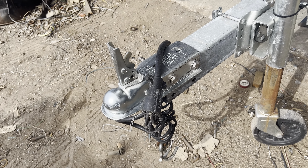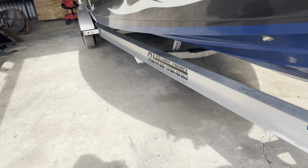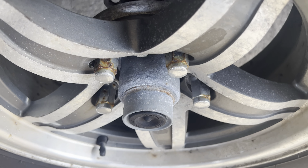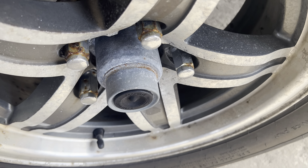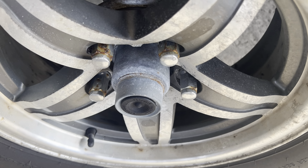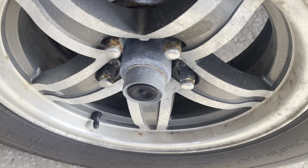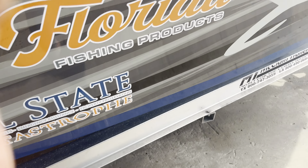We'll talk to him every month and see the progression of everything. He also has a seven-round connector on the front, which most boat trailers have as a five-flat. One more thing to point out: the lug nuts. On trailers, aluminum wheels are known to back off when they're new, so you have to re-torque them at 25, 50, and 75 miles. I'm going to replace these — chrome lug nuts on one axle and stainless on the other to show you guys the progression.